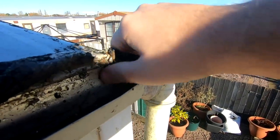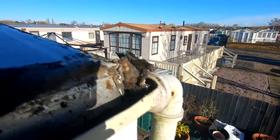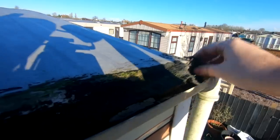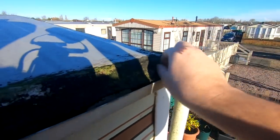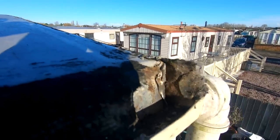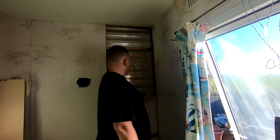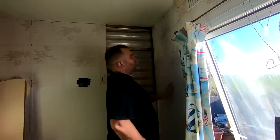So that's where the problem is and the way we can address that — I think I might get some pliers, just peel that bit of metal back there, fill it with some sealant, then tap that back round and reseal it again. And I think Chris has actually got some tape to redo this, and that's definitely going to need to be done. So that's going to be our job — that's the cause of the leak there, definitely. There's nothing we can do with that for the minute because I've got no sealant here. We have found our issue — it is obviously coming in from this back corner right here — and that obviously proves the point because all that wood is all black down there, but it is still solid so there's no need to worry.